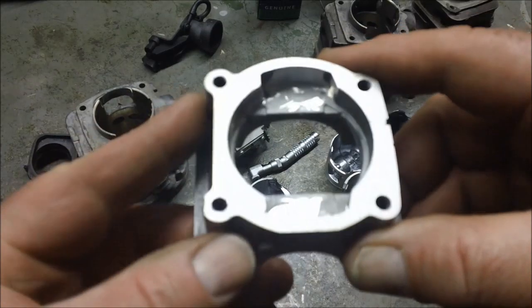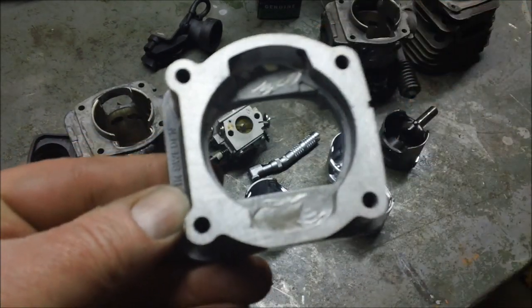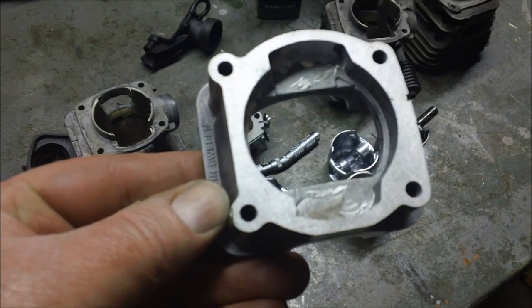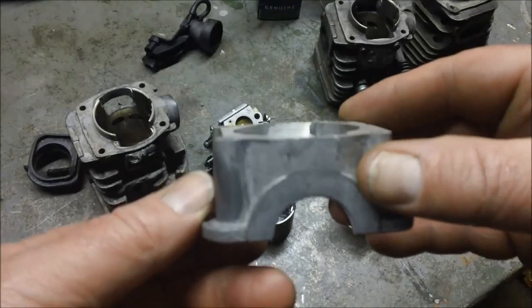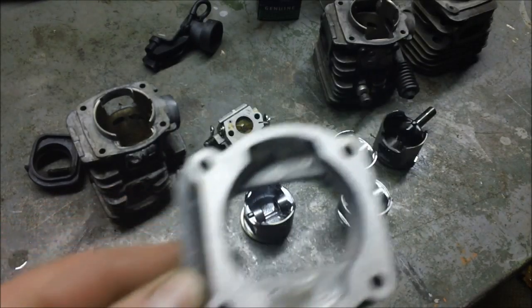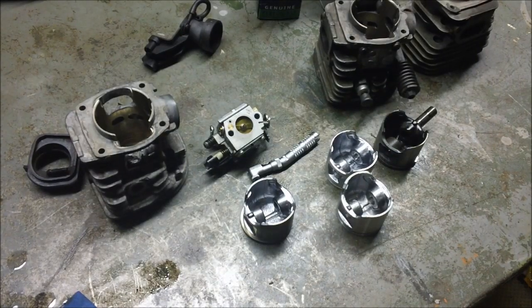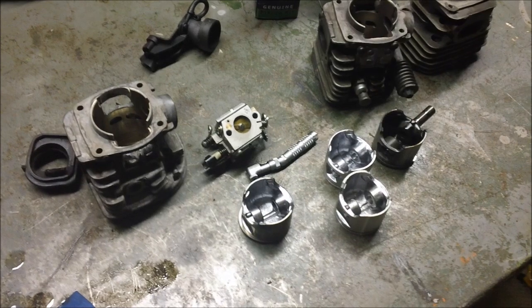And also, the bearing caps are a way, if your squish is off, when you pull the base gasket out, that takes it down some distance, but you can take down the top of the bearing cap to bring it further to get your squish closer to the 20 thousandths, and I did so on this saw. It's at 20 thousandths exactly. And I mentioned that as well.